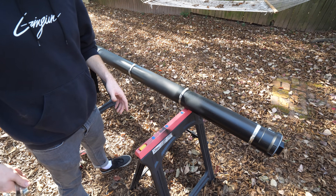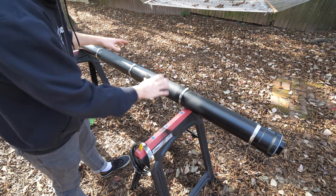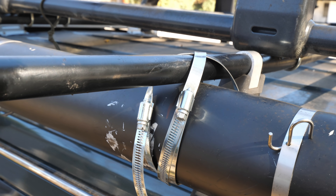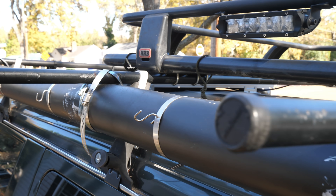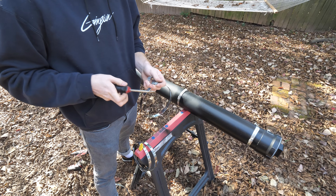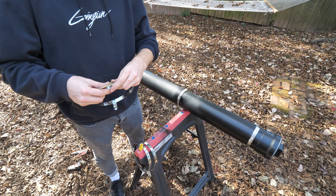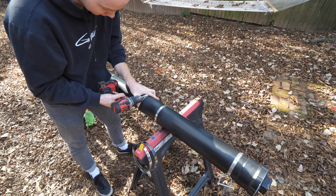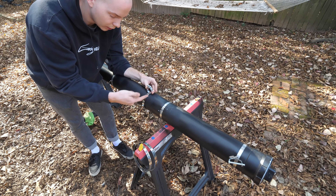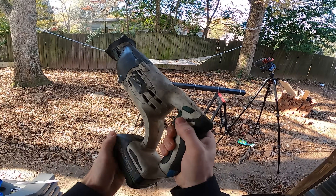My friend Andrew thought of a very simple and efficient way to attach the awning to the roof rack. Previously there were two hose clamps that went around the awning and around the roof rack pole — problem is they're perpendicular. So you take a big hose clamp, put a smaller hose clamp inside it perpendicularly, put it around the awning so the roof rack goes through the little hose clamp, and then the big hose clamp attaches it to the awning.